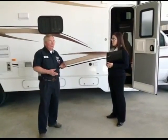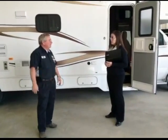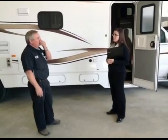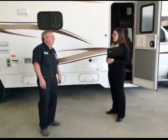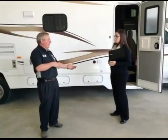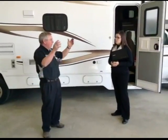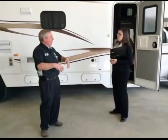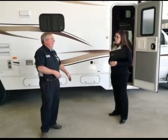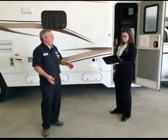All right, I think we've gone through all of our questions. Any other notes that you can think of that we should discuss as we talk about unwinterizing and getting ready for spring? Well, like I said, the things that people forget are the batteries. They plug it in and everything's working, and then they forget the tires. Tire pressure is very important. You will ruin tires by running them underinflated. Not to mention, if you blow one out, that's a big chunk of change going down the road. That's a lot of weight there. You blow out a tire, you may do some damage. You don't want that.